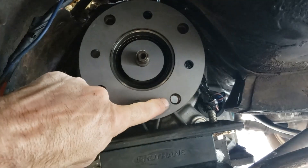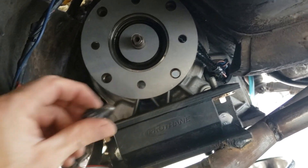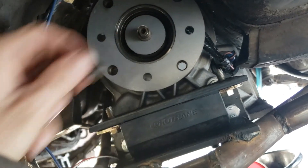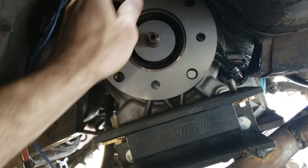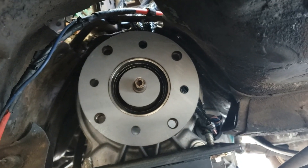So the regular M12s go in there, and I have another set of bolts. What I'm going to do is tap the 4 and a quarter spread, and the yoke is going to bolt on — there's plenty of room on the back side. So give me a little bit and I'll get this drive shaft in.